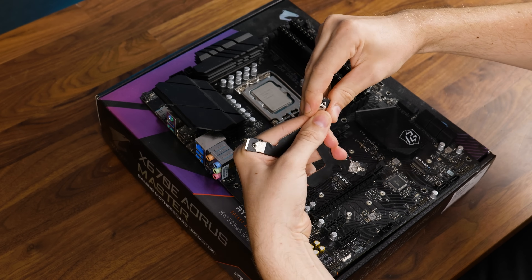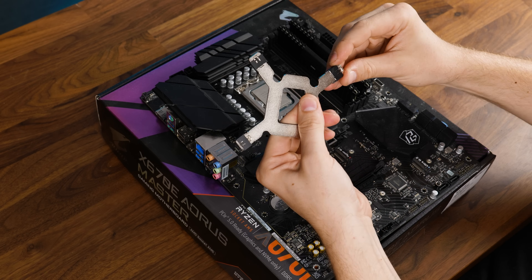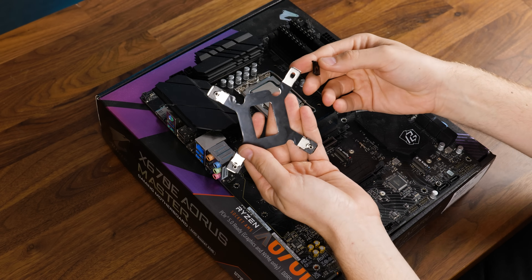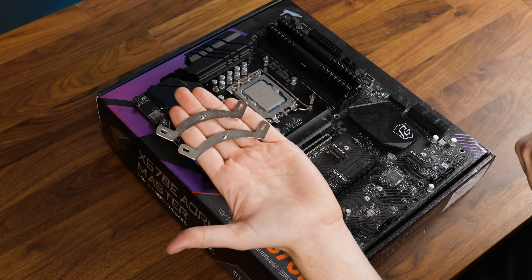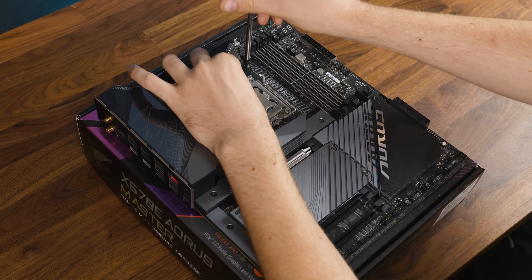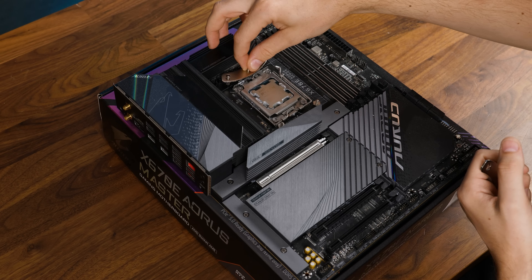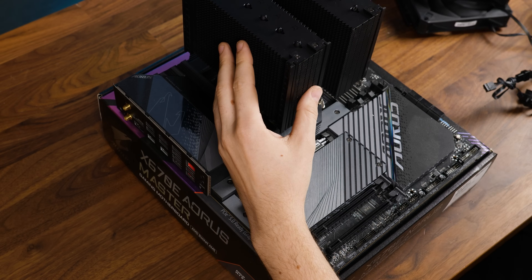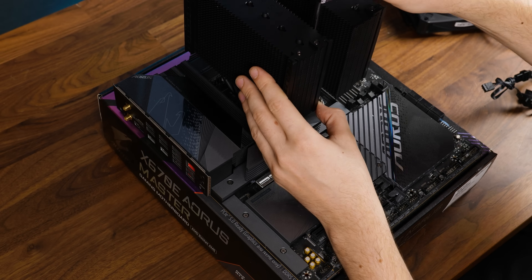The installation as a whole is fine, nothing revolutionary. I just found that the individual pieces look raw — usually it's either polished or painted, but here it's just raw. But let's be honest, nobody sees any of this after installation anyway. To get it going on Intel, we need to position the backplate behind the motherboard, and for LGA1700 we need to pull the ends outward — don't go crazy on those, because there is no hard stop. Once it's behind, we install the screws according to the socket, install the retention brackets with the ends pointing away from the chip, and screw them down using thumbscrews. For AMD, we remove the original retention brackets, replace them with the AMD spacers with the thinner end pointing downwards, retention brackets pointing inwards on top, then screw everything down. From there, just slap the cooler on top and screw it down.